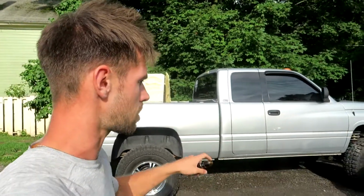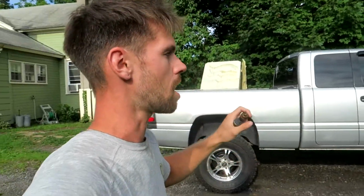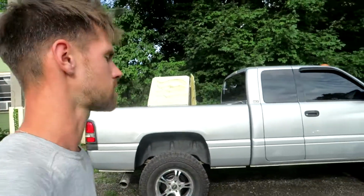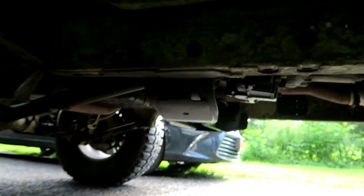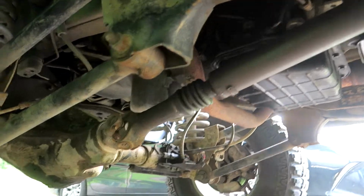The 4-wheel drive light doesn't come on, and the U-joints are clicking when the 4-wheel drive is engaged and you start to go. There's a clicking sound coming from what sounds like right underneath the driver's seat. Pretty positive it is the U-joint closest to the transfer case that is the worst, but all of them, there's three of them down underneath there, they need to get replaced. Now I have all new U-joints that whoever buys the truck can take, but I am not going to put money into this thing as I'm trying to get rid of it.